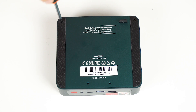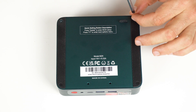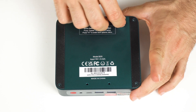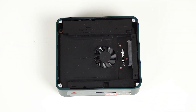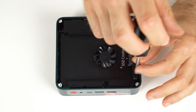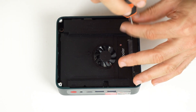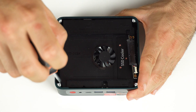This is another mini PC where the screws are easily accessible — and doesn't that just warm the cockles of my cold, dead heart? After the four screws are out, there's a piece of rubber to pull on. Inside is what we've seen with the Beelink Intel-based A12 mini PC, which is a fan for cooling the SSD. There's also space for a 2.5-inch storage drive if you need it. Two screws need to be removed to lift the SATA connector, then more screws holding the SSD cooler in place. Keep track of the screws — they aren't all the same size.